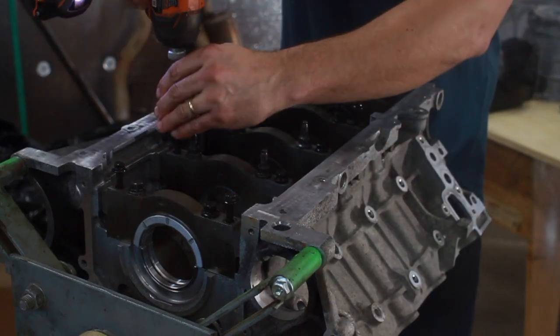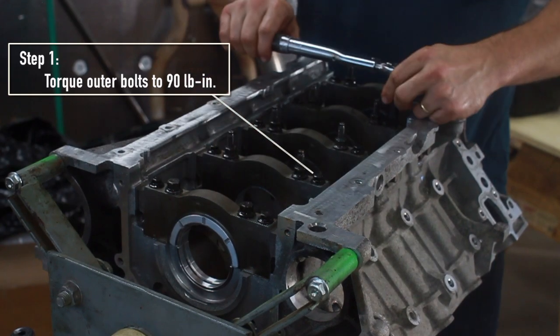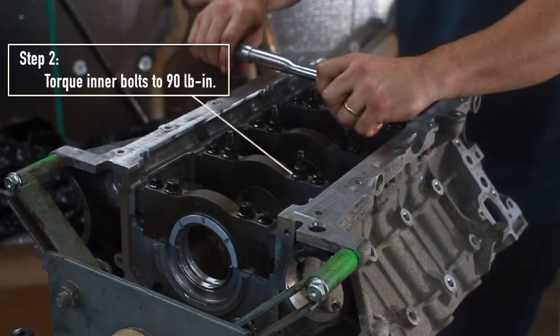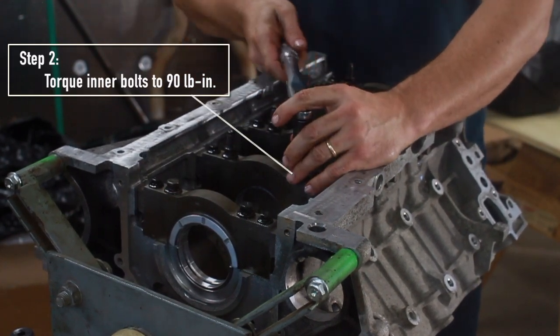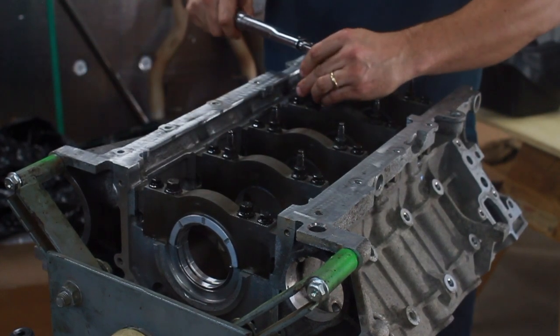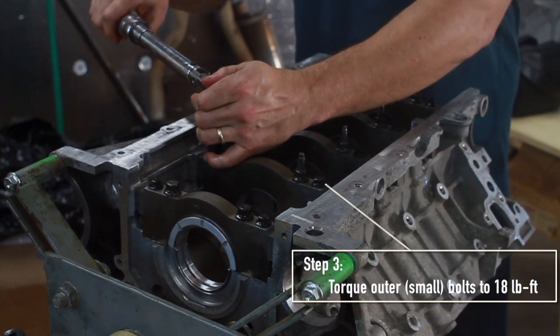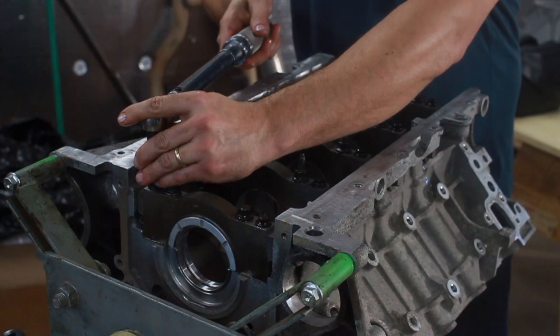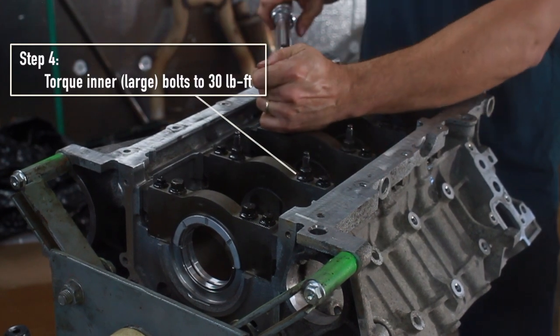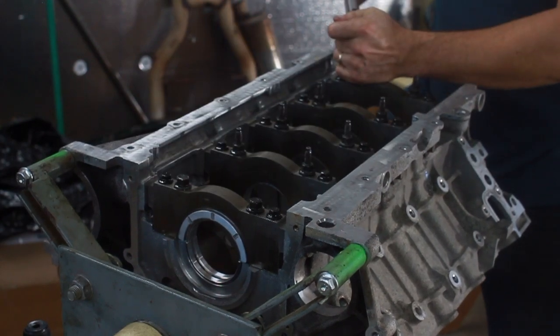With the additional clamping force of the high strength bolts, such as an ARP, it is generally a good idea to have the mains align honed, as the additional clamping force can sometimes distort the main bearing housing, which could lead to a whole lot of problems for you. So rather than spending the additional money on the bolts and the machine work, I went with the torque to yield bolts from the factory because the bottom end of these blocks is usually pretty good,